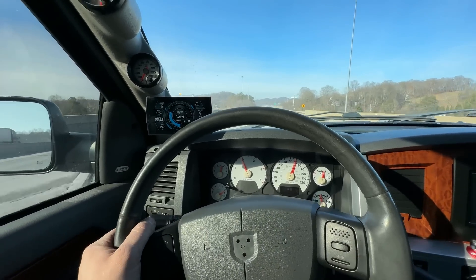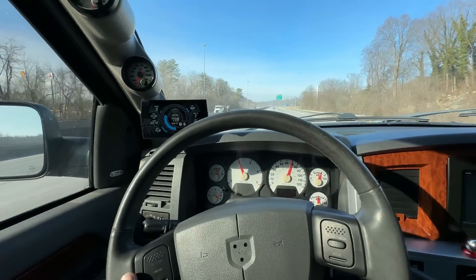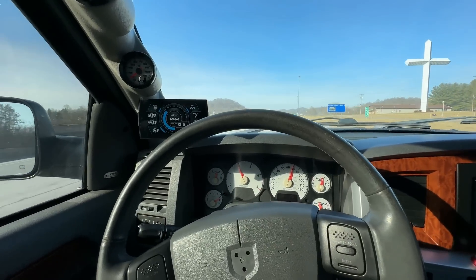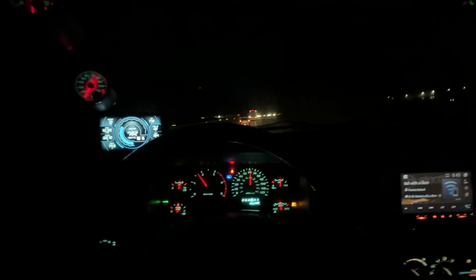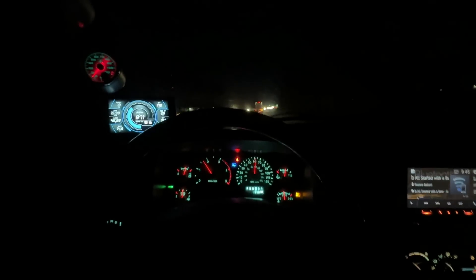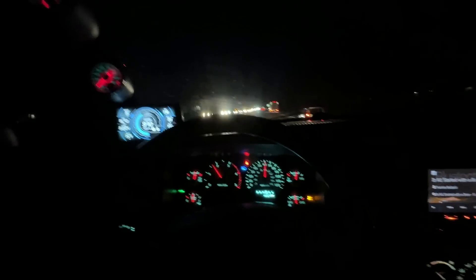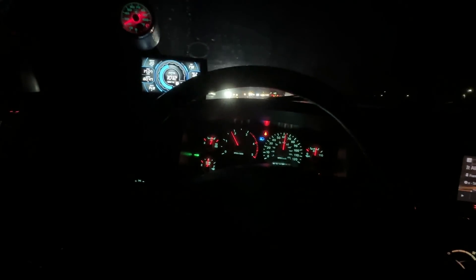We are on our way home. We secured a project — I'll show you guys once we're back. The seller didn't want to be on camera, no big deal. We are currently towing 24,700 pounds with a stock 48RE. What I've found is if I give it too much throttle it actually slips the converter, so we're riding that fine line — trying to keep boost below 28 pounds.